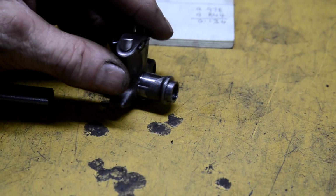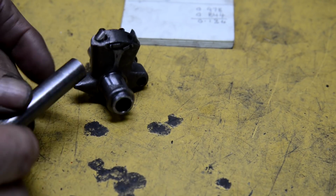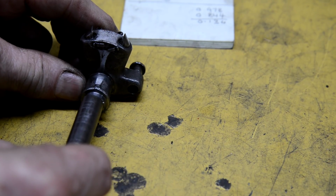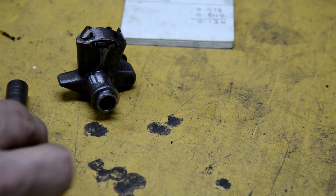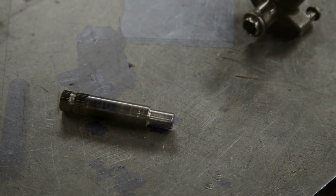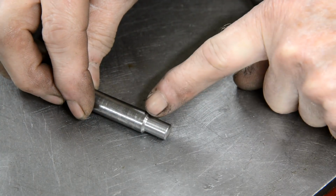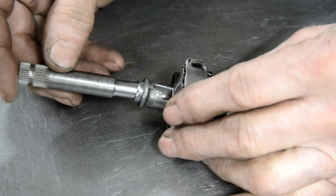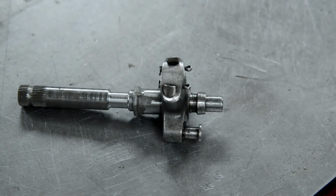And then what I can do is, as I say, I'm going to drill the hole slightly smaller, so I'll drill it in, and I know I'm going to come out here about 1/8 of an inch. So instead of 7/16, that's another 1/8 of an inch that we'll turn it down to. All right, so you know what we're doing. So there's stage one done. Cut it and drilled it. So now I've got to turn this down for 9/16 to be a good tight fit in there, and then we'll put a little chamfer on both edges, weld it in, and it'll be a good strong repair. Now, stage two, put this back, put our little chamfer on. So that should be a good tight fit in there.